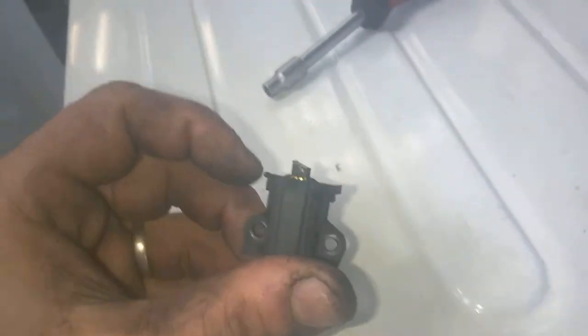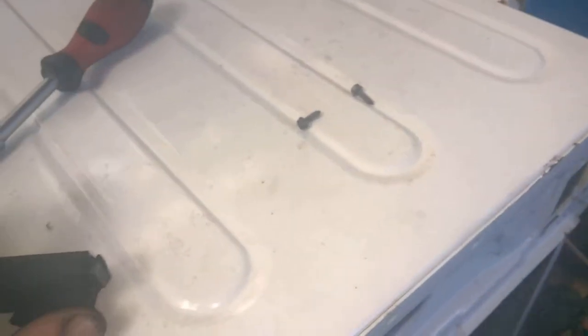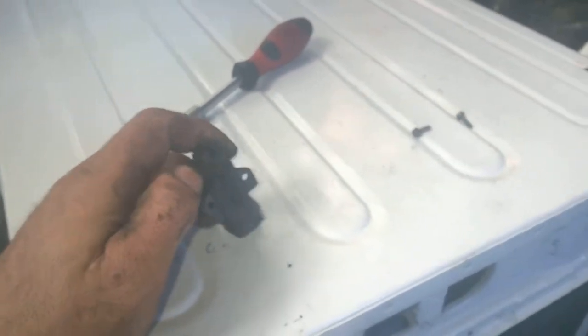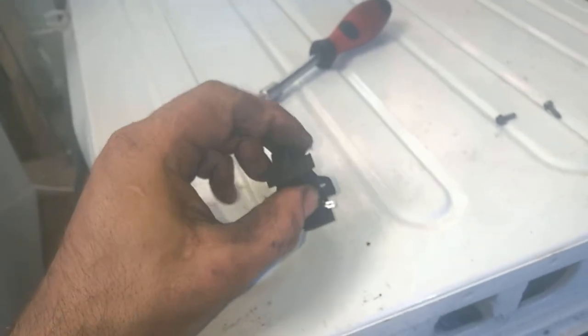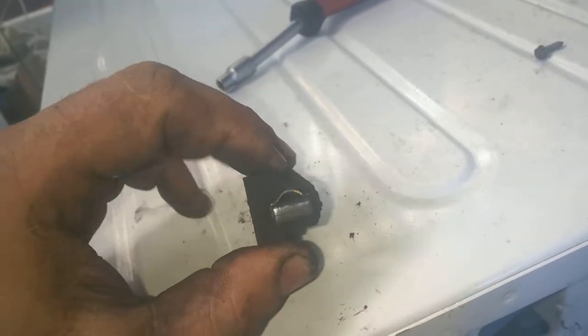I got one of the brushes out — look how small it is. It should be about this size when new, so it's completely worn out. Take a look at the commutator — it's completely scratched; that scratch in the middle is an indication of arcing. Don't try to sand it too much — just clean it a little with fine sandpaper, because if you sand too much and don't know what you're doing, you'll end up shorting it. If you are a beginner, just buy new brushes, fit them and leave it as is. It will probably arc a bit for the first minutes of operation, but then everything will settle.